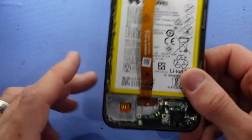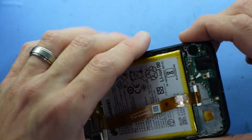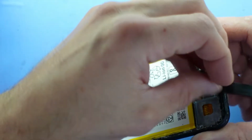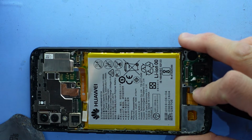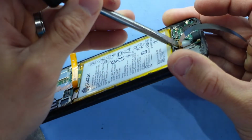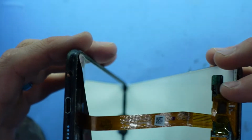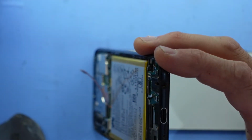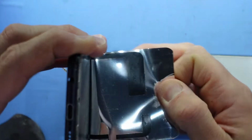So what I'm going to use, since the front of this has been getting heated up while it's sitting here, I'm going to hold the frame and push a flathead screwdriver through this gap here and push the screen out from the inside. Being that it has been replaced, it should come out hopefully relatively easily, but we'll soon find out. So I'm going to go like this and push, and that's coming out extremely easy for me. So from here I can just grab it. And funnily enough, it has separated and the silver reflection has stayed. So we go like this.